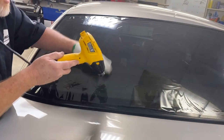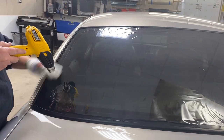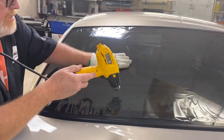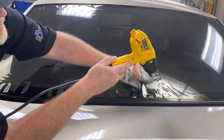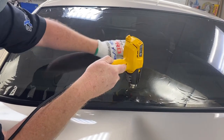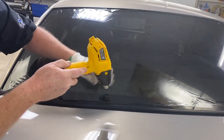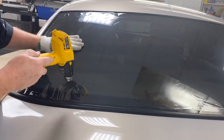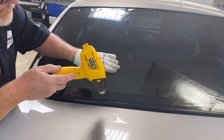I keep lifting it up because I don't want to overstress the film in certain spots. That's one of the pressures on some vehicles that causes peanuts. So I lift it up, put a little hot air in it, move it over — lift it up, put a little hot air in it, move it over.